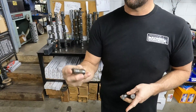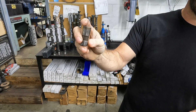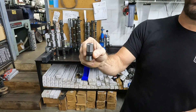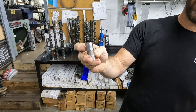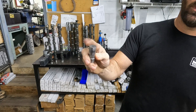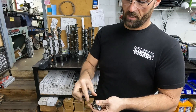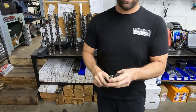This is a Delphi lifter out of the same engine that the mid-80s cam came from — we're going to check it for hardness. This is a brand-new China eBay special hydraulic lifter set — I think they were $45, just super cheap. And this is an import lifter that we sell with a hard foot, a stellite foot — we've had really good success with them. We'll check all three. I had some solid $300-a-set oil-hole lifters, but they were actually the softest out of the pile. The most expensive ones were the softest.